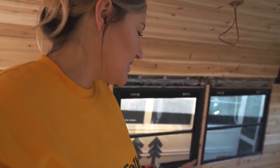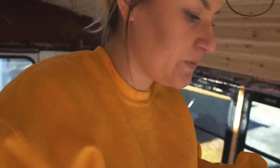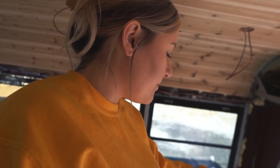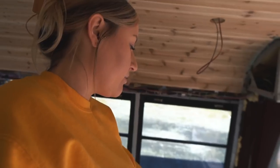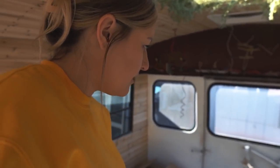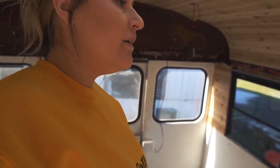So what we're going to be doing today is basically replacing the diesel heater, and what I'm going to be doing differently this time is it'll all be hooked up the same. I'm going to take that thing out, put the other one in, and I think this fuel tank is actually bigger, so I'm going to be keeping that, but I'm going to route the fuel tank over to the back side, and I won't be attaching it to the wall just yet because I still have some stuff to do to that wall, but it will be over there so that when I go get fuel, I can just open up the back door and I'll be able to fill it up right then and there,